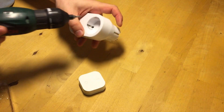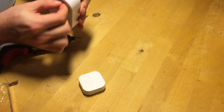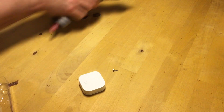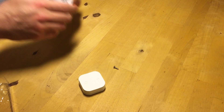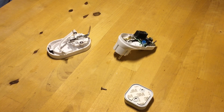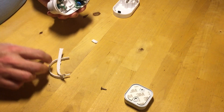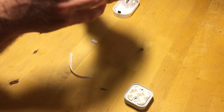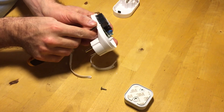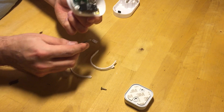I have not tried before to disassemble it, so let's see how it goes. It's a Torx T10 you need to use to open it. There are no stickers or anything, so I had to resort to using a Dremel, which I of course don't like. What I learned was that this part was slightly glued in. There's some glue here, so it would have been possible to take a screwdriver, jam it in, turn it all the way around, and then lift it up.